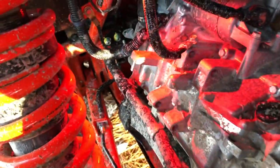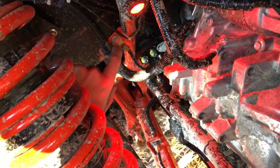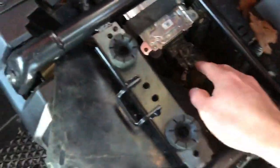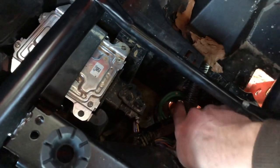If you lean over the back tire and look in, you can see there's a ground wire. From the factory they don't do a very good job of cleaning the paint off behind that ground — this can cause a connection problem from your battery to your engine and computer. I took that off and cleaned it really well. Then I came under the driver's side rear passenger seat, removed the rubber cover, which exposes some of the computers. The green wires under there are the ground wires for the computer and they mount to the frame with a small screw — I took that apart and cleaned it really well, removing all the paint.